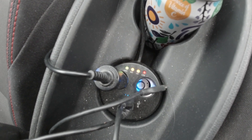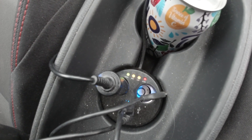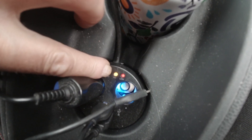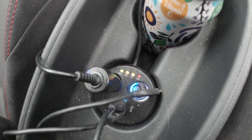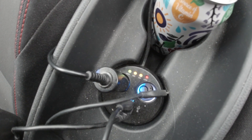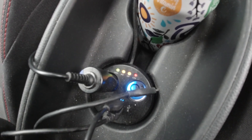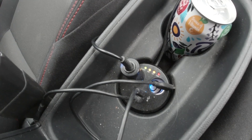If the red light is lit up, you know you've got a 12 volt battery issue. If it's showing on the first amber light, the car will still start. If the red light is the only one lit, you either need to charge your 12 volt battery or go to Toyota and find out why it's not charging — it could be nothing more than not using the car enough.